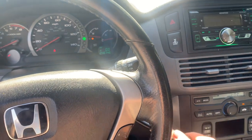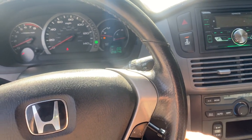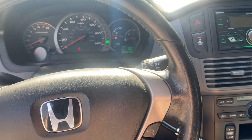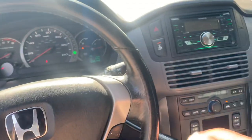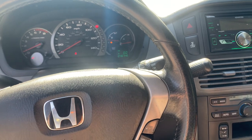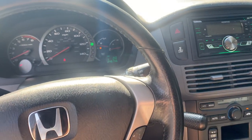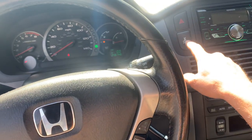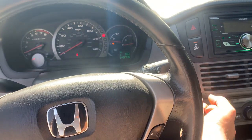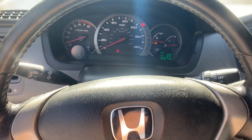It works in first gear, second gear, and I think even third — actually no, just first and second. You'll see it on the dash: 1, 2, D3, D4. So first gear, second gear, and reverse are the only gears where four-wheel drive will work. If you're off-roading and hung up in Drive, smashing the four-wheel drive button with nothing happening — go down a couple gears. It also works in reverse, and neutral turns it off.